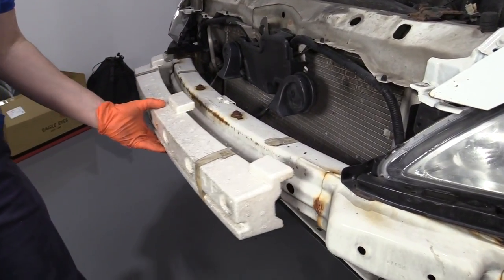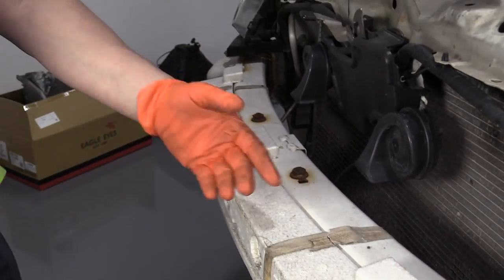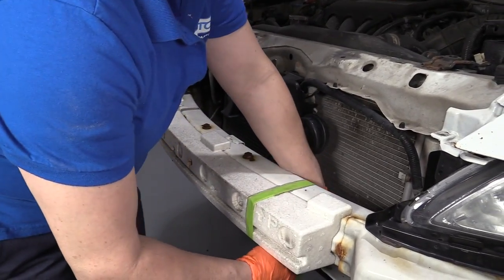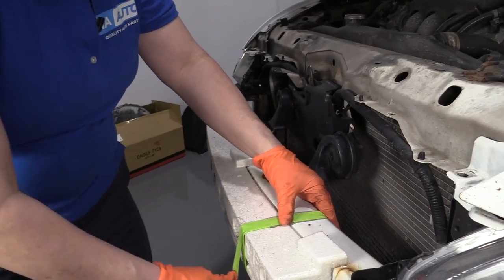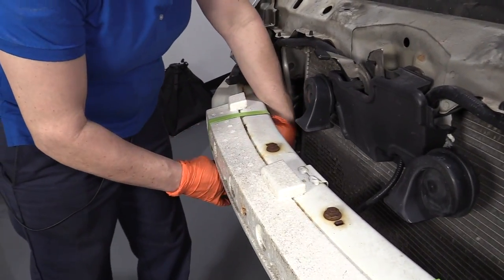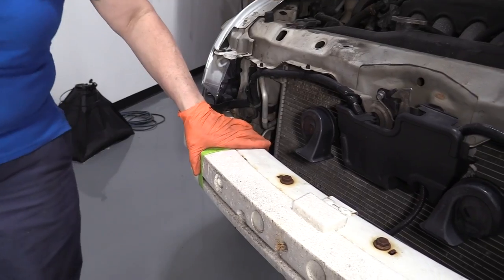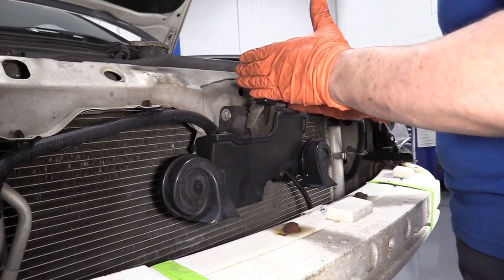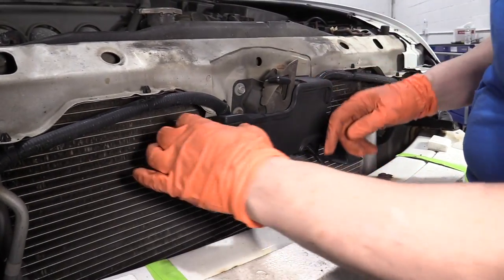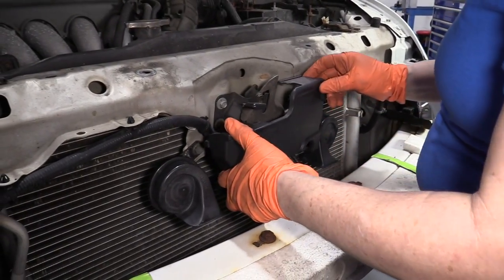Whenever we're removing a front bumper, this Styrofoam bumper cover is factory and they usually just use masking tape. As you can see, that's straight from the factory. The weather has worn our tape here, so I'm just going to quickly tape this so it's sturdy again and easier to work with. The latch is located in the front of the hood, right in the center. We've got a plastic cover to remove first — there are two little tabs on the corner and one at the top. You're just going to pull out on it, same on the other side, and lift it up and get it out of the way.